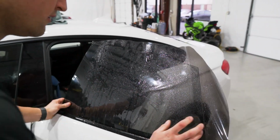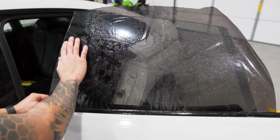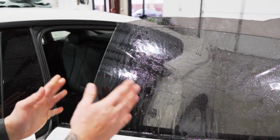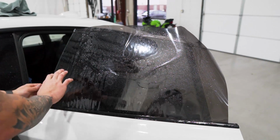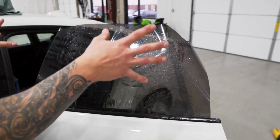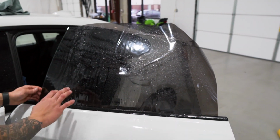Release that, and we're going to take the front edge, and then we're going to shift it back so that we have a gap about 1/8 of an inch. You want to make it so that it's double what you want the gap to be on the entire perimeter. So we're going to shift this back and mount it into place, cut the top and the back edge, and then we're going to release that, and we'll do a test fit to make sure, but that should line up perfectly around the entire perimeter.